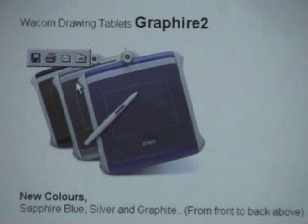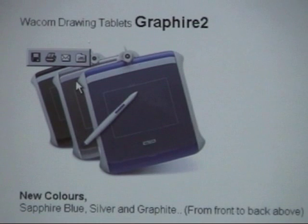If you're thinking about using a mouse or a trackball even for video editing or picture editing, when you buy it, look at the DPI. It'll be somewhere on the back of the package. It'll talk about how many dots per inch that thing can resolve. The more DPI it can resolve, the more accurately that mouse will track for you. Some of those little cheapo PS2 mice with the balls in there have a DPI of about 75. The optical mice have ones around 400. I've even seen ones that are up almost to 1,000 DPI. The higher the better, the more cost.